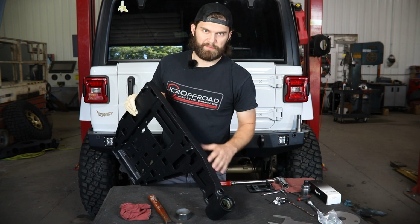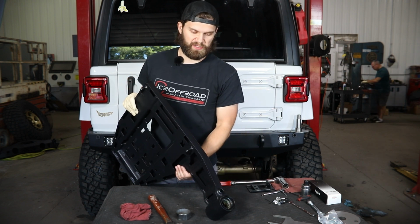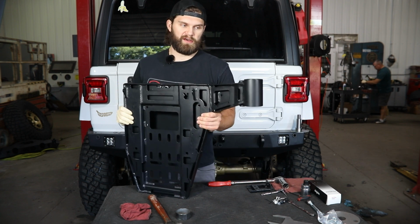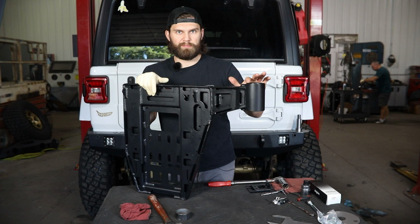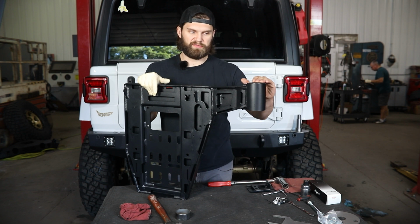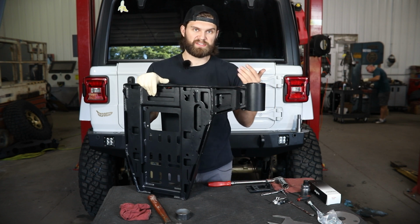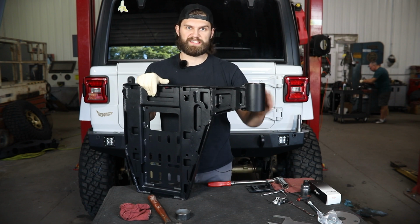So with that seal tapped down in, that's going to hold that bottom bearing in place as we go to set it on the spindle. Now, as far as how far to push it down in, you can maybe kind of see there, mine's sitting about a 1/16 inch proud of the carrier itself. It's not going to hurt if that goes in just a little further and is sitting flush, but there's not like a hard shoulder stop down in there machined in to stop that seal.